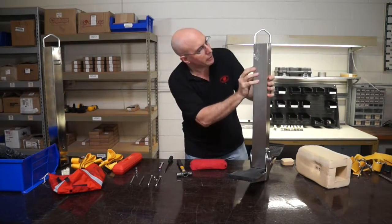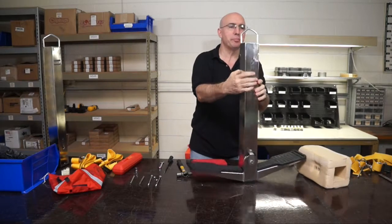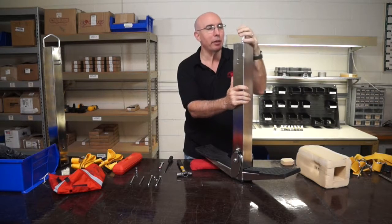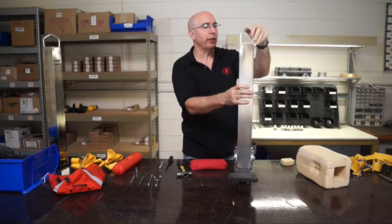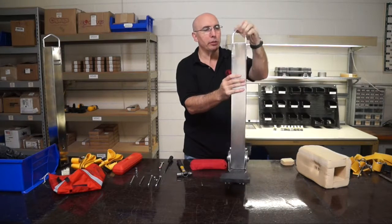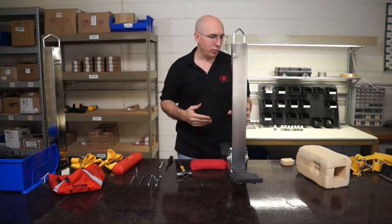Now you'll do a quick inspection — look inside to make sure we don't have any deterioration, any cracks, any deformation. These are seriously over-built devices, so it's probably not going to be anything wrong, but have a look. If there's anything suspected, if you have any cracks that you suspect, then you can send it to NDT. It's a seriously over-built device. Just have a look at it. Everything looks good — I'm going to go ahead with my cover replacement.